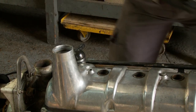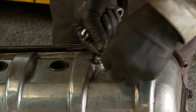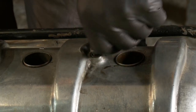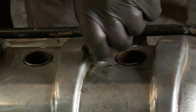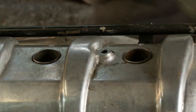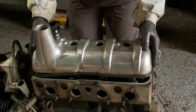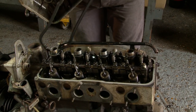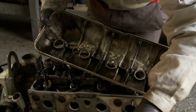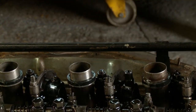We'll take the cap off just for a moment and undo this bolt. This is quite a nice shiny rocker cover — someone's taken the time to polish it. Slacken off the rocker cover — there we go, and the gasket's coming with it. And once again there is evidence of emulsion with the oil in the top of the rocker cover — all looking rather horrible and gooey. That will be cleaned up, not a problem.